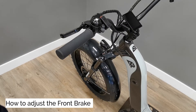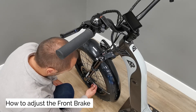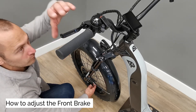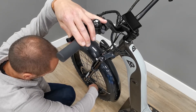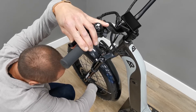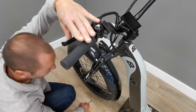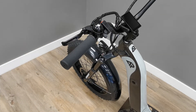How to adjust your front brake. To make sure your front brake is well adjusted, we suggest to unscrew the caliper bolts only with your wheel correctly installed in the fork. Then grab your front brake lever and tighten the two caliper bolts. If you can still hear your brake pads rubbing on the disc, then center the caliper as best you can in order to take the rubbing noise away.